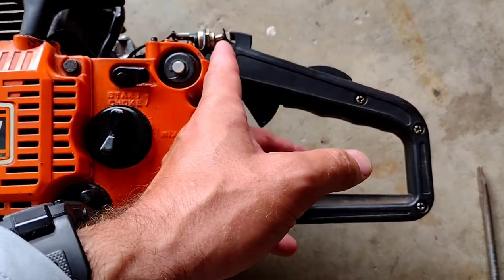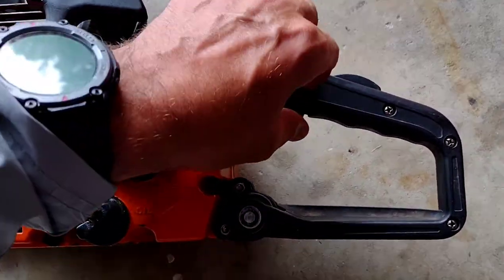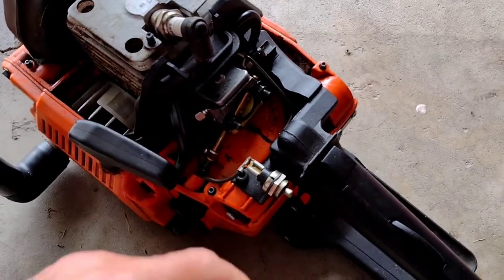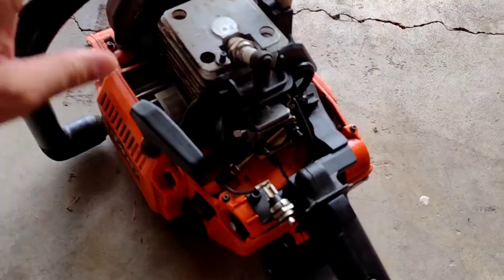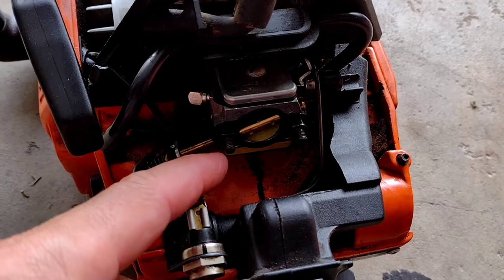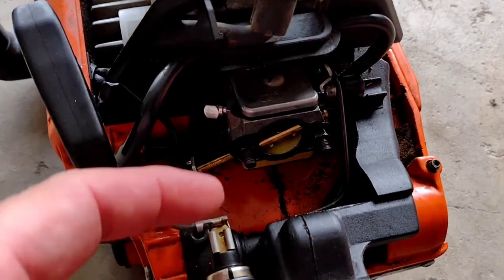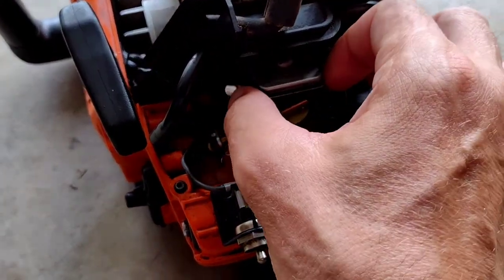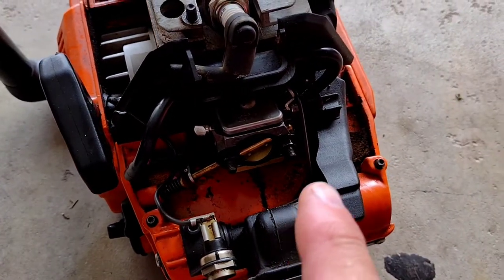There are one, two, three, four, five, and then six screws — you've got to turn the handle a little bit, there's a sixth screw down in here — and that takes this side of the handle off. But what I think you can do is break the nuts loose on the bolts that hold on the carburetor. Like on a Stihl, the bolts have a hex head that sits behind the carburetor keeping it in place. Here I think if you break these nuts loose you can actually unthread the bolts and pull the carb out without bending the throttle linkage — and I think that's the proper way.